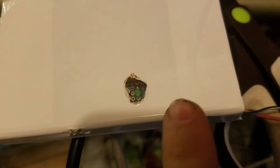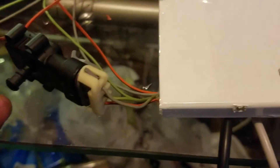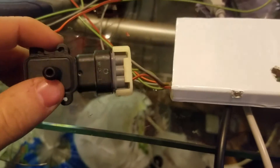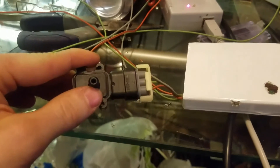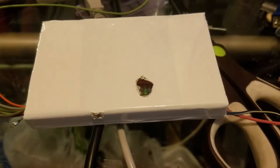This right here means that the injector's on. So if I put a little bit of vacuum right here, you can see that light turned on, which means the injector was then off because it was under vacuum. Under boost, I set it to 95 kPa just so it hits right before boost. The injector turns on.